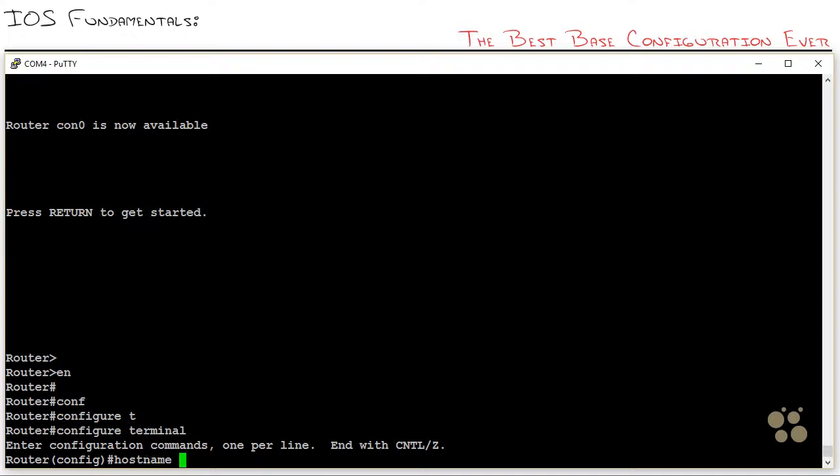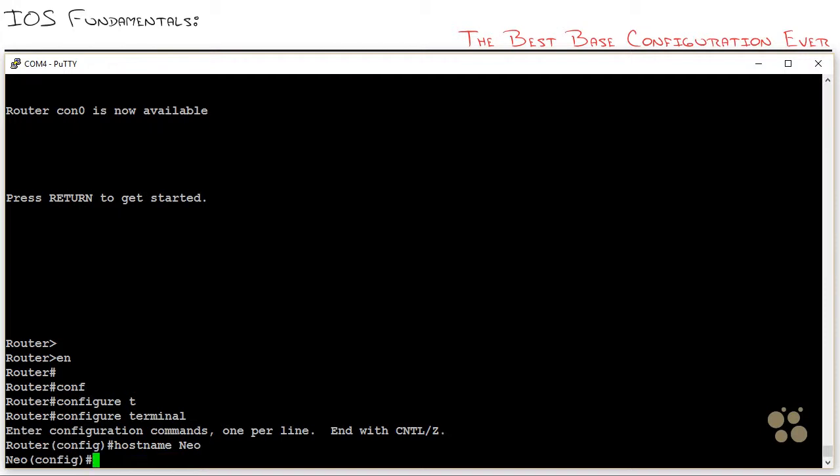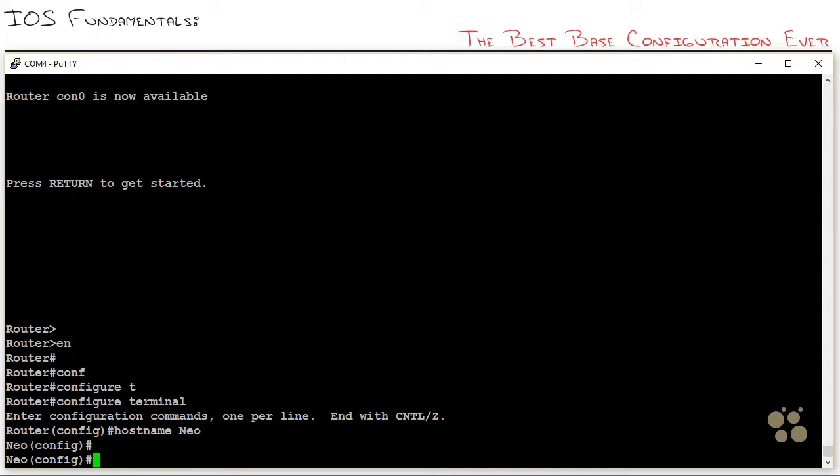So at some point you would have a host name that you would pick for this device. Now there's many different mindsets around this. Some people say, well, this will be B1-1F-2R, in some code name where they're like, okay, this means building 1, floor 1, switch 1, or in the second rack. And I have seen white papers written on large companies' naming conventions where every letter means something and it's deep and meaningful. For me, I'm like, Neo. That's going to be the name of the switch. And as long as you document well, Neo is fine. Morpheus, Trinity, they can all jump in on this game. And you can set up superhero networks and comic books and all. There's no right answer.